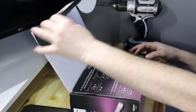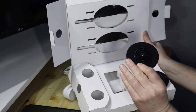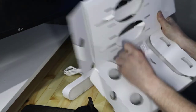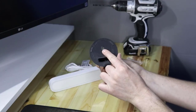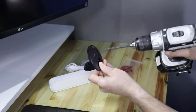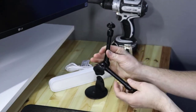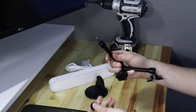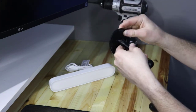First, let's show you how to connect the Philips Hue play bar to the camera mounting bracket. Grab a couple of things from the play bar packaging. You'll see two different types of stands — make sure you use the upright stand that sits at a 90-degree angle. Next, you'll need the baggie that has the 3M double-sided tape, tiny screw, and allen wrench. On the underside of the stand you'll notice a small circle ring. Take your 7/32-inch drill bit and carefully drill a small hole through the center of that ring. Then grab your camera mount and remove the top threaded adapter.